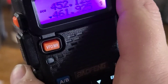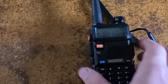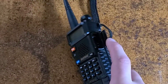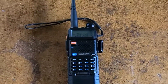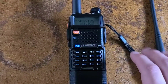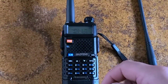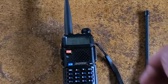When you hit this button you get FM radio. If you hold monitor it monitors, and if you press the PTT you're going to transmit. It uses the same general Baofeng programming cable, which is not sold along with this unit — you do have to go grab it yourself or order it off Amazon. Just so you're aware, it comes with the same factory unlock as the UV-5R, meaning it is able to transmit outside those bands, so you do have to be wary that you don't transmit outside the preset bands it is intended for. Nobody here would ever want to break the FCC's rules and regulations.